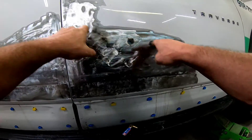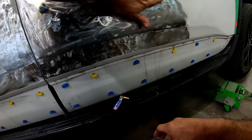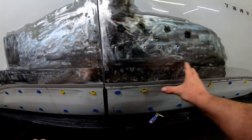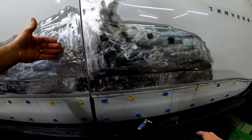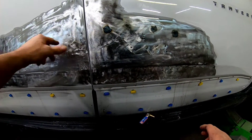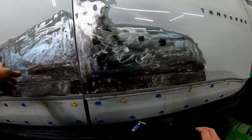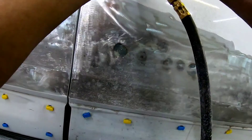Now this panel is nice and firm. If I feel around it, it's not really flexing easily. There's going to be some flex to it no matter what, but you just don't want it to feel like a tin can — you want it to be pretty firm to apply that filler. Now we need to prep out this area for some filler. I'm going to use my 36-grit roll lock on my angle grinder to grind all the metal clean, and then prep out the paint around this repair area with some 80-grit on an orbital sander. We want to put 80-grit scratches in that paint edge so when we apply our filler, we can lay it just over that paint edge and over the repair area, and then block it out.